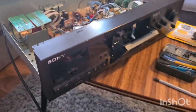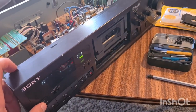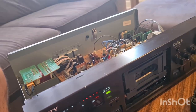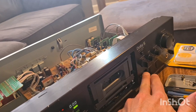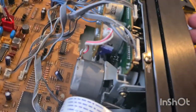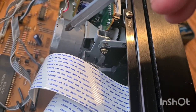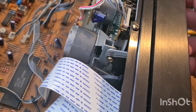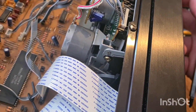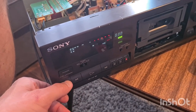That's powered up. Have we got everything in? Yeah. That's a good sign — it's not making a clacking noise. Is it going to close and open? No. Okay, that's interesting. I might just need a bit of a reset. Down here, this cog and this motor controls your open-close mechanism. It is turning, but it looks like its part's getting stuck. What is good is it isn't making the clacking noise it was before, so the mode select looks like we're good. There's no tape in it, so it's not going to do anything.